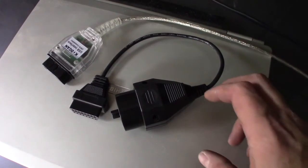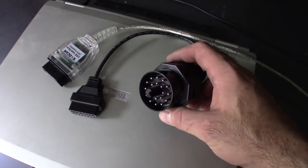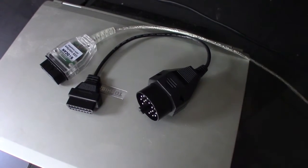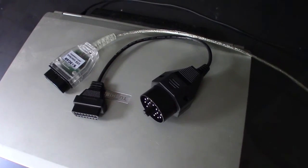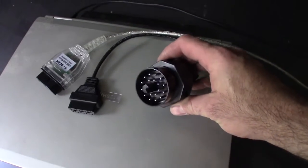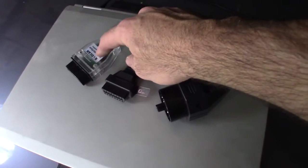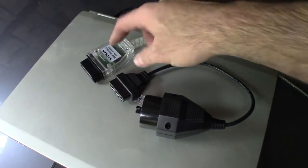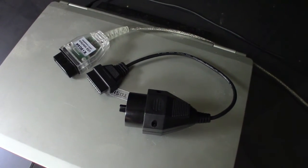By the way, if you have a 1999 or a 2000 model, you very likely have one of these round black connectors underneath the hood of your car somewhere. It's probably in the well that's opposite the one containing the brake booster and the electronics box. If you see something in your engine bay that this kind of thing would plug into, you need one of these adapters in order to use one of these cables on your car. If you look on eBay when you buy this cable, you'll see packages where this adapter actually comes with it, so just be aware of that and get it if you need to.